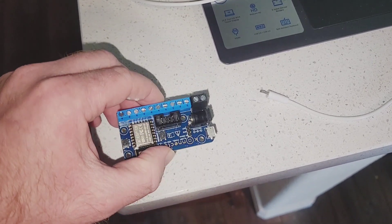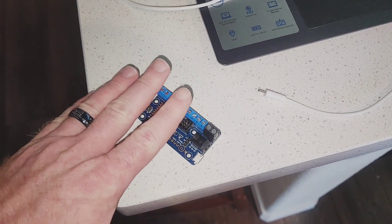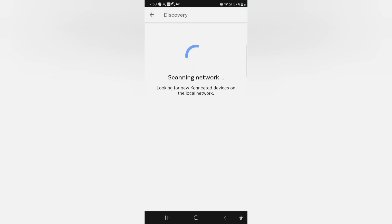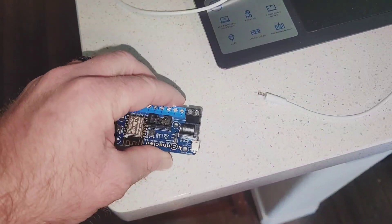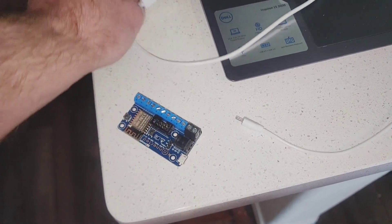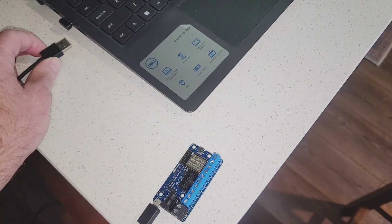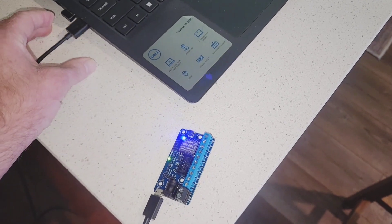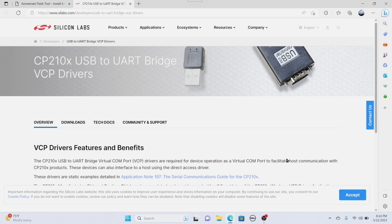Now I'm going to show you how to install a firmware upgrade if your device needs that. I bought my kit back in 2020 and it's now 2023. I tried to connect it and the app could not find this on the network — you'll just get stuck at this screen. I was told it just needs a firmware upgrade. Right here you have a micro USB port, so I got a micro USB to USB cable to plug it into my computer and hopefully run the firmware upgrade that way. Let's go ahead and connect it to the computer. It senses it. I had emailed tech support and they sent me a link — I'll leave a link in the description if you need it. You need to download the drivers for it.